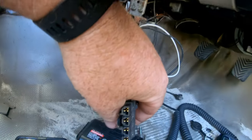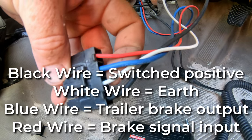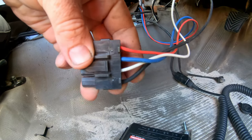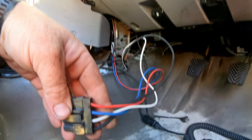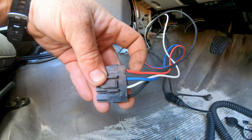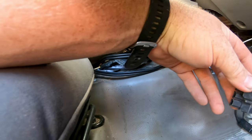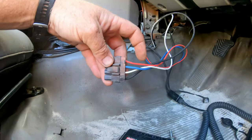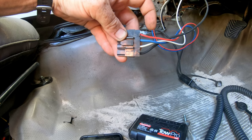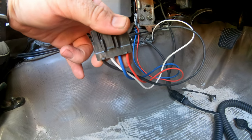The wiring side of this install is super easy — four wires: negative, switch positive, brake feed out from the controller, and your brake light feed in. Your black and white you just send to a switched source, which for me was off the back of the head unit — the CD player. Then brake out and signal in. I just ran a twin core wire the full length of the car, so one end joins the red wire and then one end is the blue wire. The signal goes up to here, hits the controller, goes back down the blue, and out to the trailer to control the brakes.